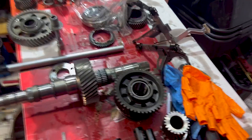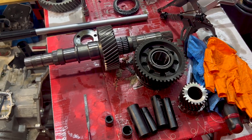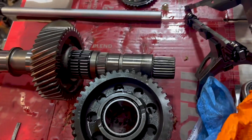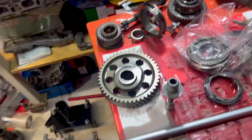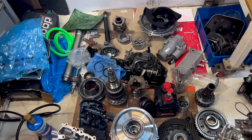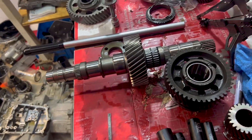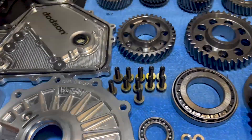Day two, Wednesday. Day three - core long haul time. We battled this old girl. I had to heat the shaft to a million degrees and the air is not great, but we got the nut out. I've got the output shaft stripped - one of them anyway - and the back sides of the carrier stripped. Looking pretty good. In the morning I'll run everything through the sonic cleaner, clean the cases up, and do everything I can to make sure it's all cleaned up ready to go.